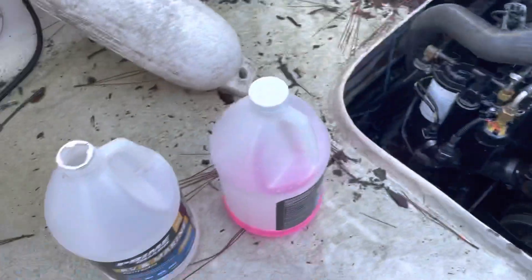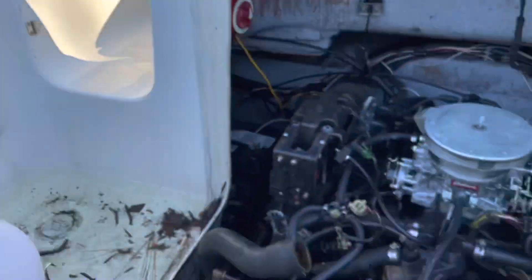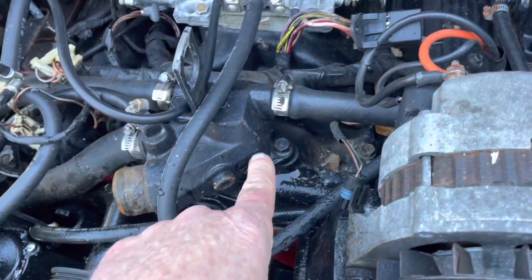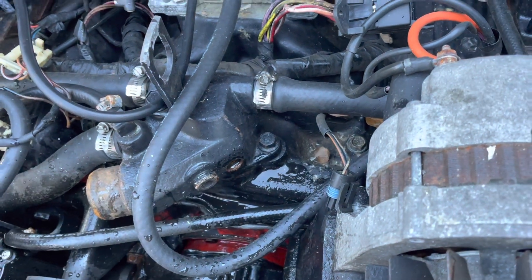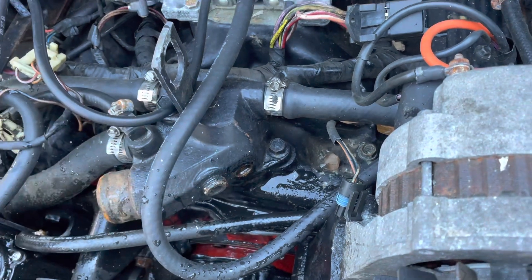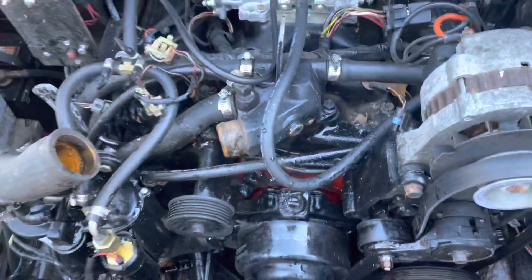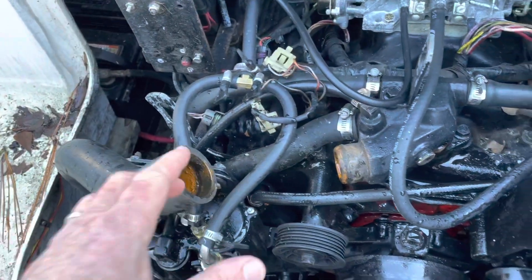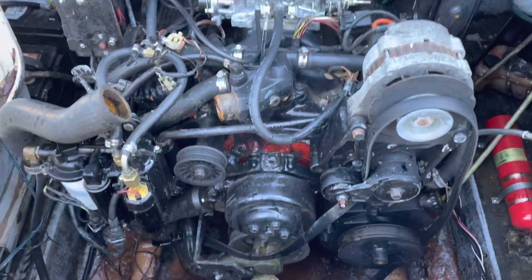So far I've poured not quite two gallons of this antifreeze into this hose. Finally, fresh water came out both holes — it was clear at first, but eventually it turned pink. So I know the antifreeze displaced the water in the engine and it came out pink, meaning the engine is fully full of the pink antifreeze. In hindsight, I didn't need the compressed air at all — I could have just poured the antifreeze in this hole and it would have displaced the water on its own.